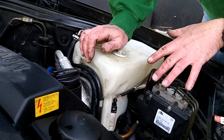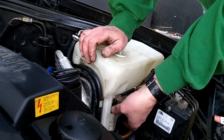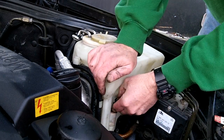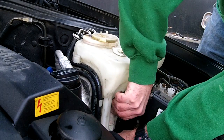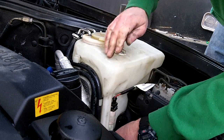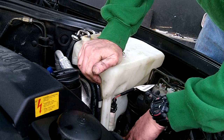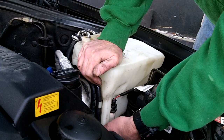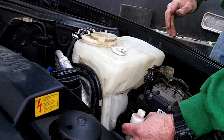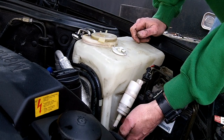Take out the front pump first if you've got one — it's easier. There's an electrical connector with two metal spring clips pushing on them. Pop out the front pump by turning the hose so it's facing forward, then simply pull up. Grab the electrical connection, unplug it, and that's your front pump. This little nozzle goes down to suck fluid from the bottom of the washer bottle.